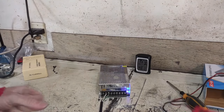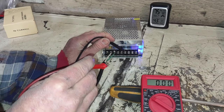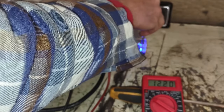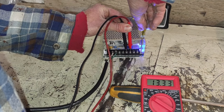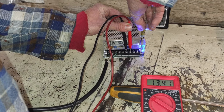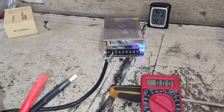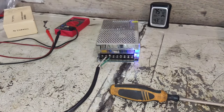Alright, we've got power. Let's see where we're at — so 11.7 volts. And let's adjust that here and take it all the way up to 13 and above. Since the heater is designed for a vehicle, that would be about your standard voltage coming out of a charging system — 13 and a half volts. So we'll go ahead and run with that, and now we'll go ahead and hook this guy up to the heater.